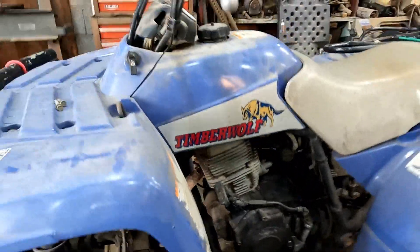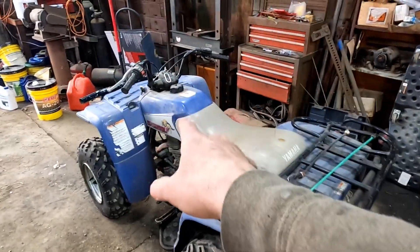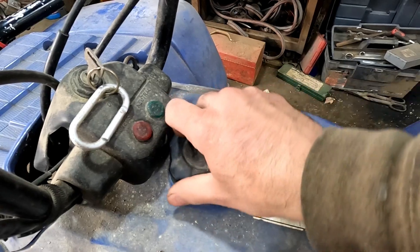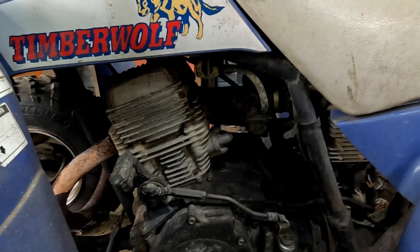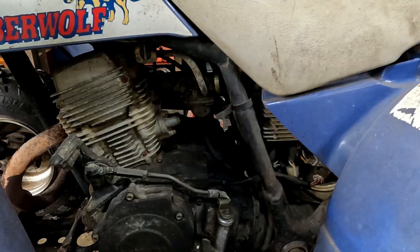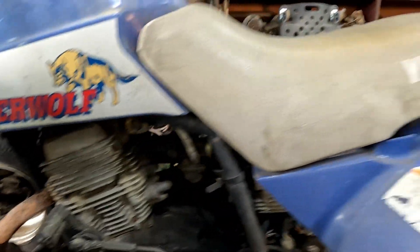We'll see if we can find the year on there somewhere. It was parked running, so it's probably going to be your typical — just go through it, check fluids. I know it's full of gas and this gas is going to be old and horrific. It smells bad, it stings the nostrils. We're going to completely drain the tank — it is almost completely full of old gas. We'll have to pull the tank and drain it, which means we're definitely going to have to clean the carb. We'll also check the air filter and clean the petcock. It was left on, and it has seized, which is not a good indication of what our carb is going to look like inside.